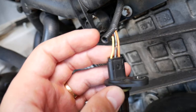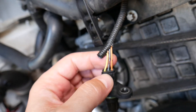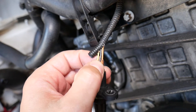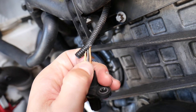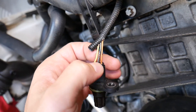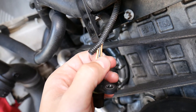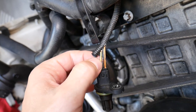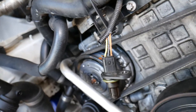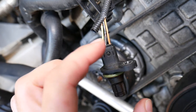You will have three wires. Colors may differ, but usually you have a black wire — or something that looks black — which is a thinner wire. That's most likely the negative ground wire. Then you have two other wires: one will be a 12-volt ignition wire, and the other will be a 5-volt signal wire going to the engine computer.